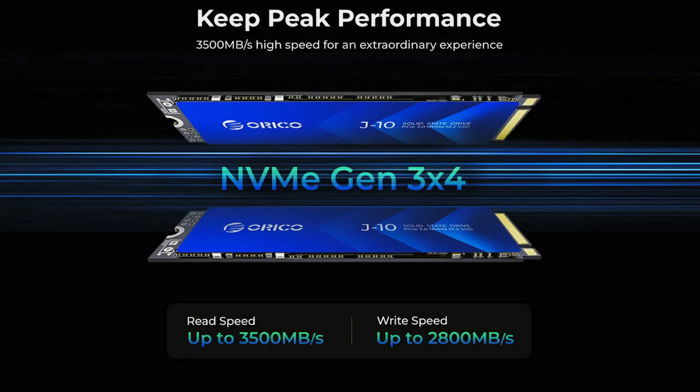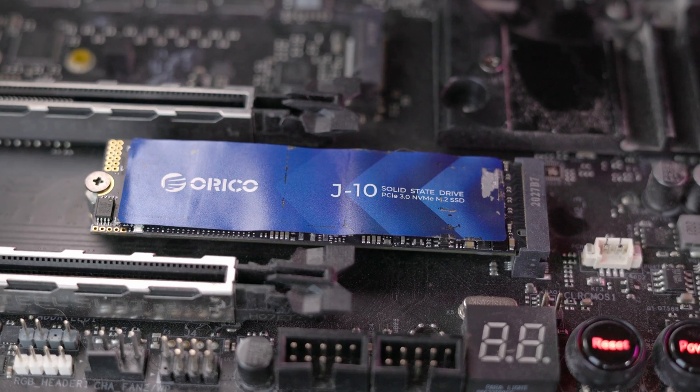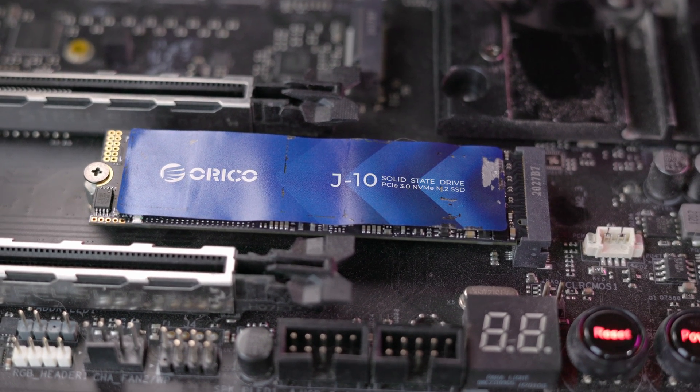Taking a look at the performance of the J10 SSD, this drive is advertised as having a peak speed of 3.5 GB/s read and 2.8 GB/s write. Using CrystalDiskMark on a freshly formatted drive, I couldn't hit those numbers — I got 2.8 GB/s read and 1.3 GB/s write on a 5950X system plugged directly into the onboard M.2 NVMe slot. I also tried a Z690 system with similar results. It could be that the rated speeds are for larger 2TB capacities, as smaller drives are typically slower, but there's no clear table showing different speeds per capacity, which is disappointing.